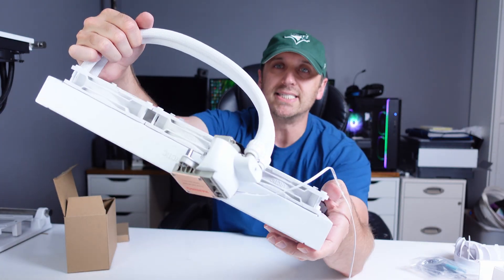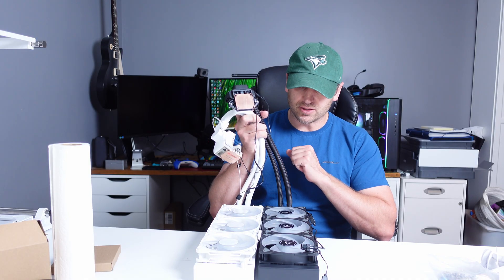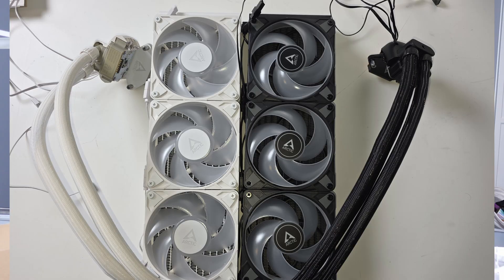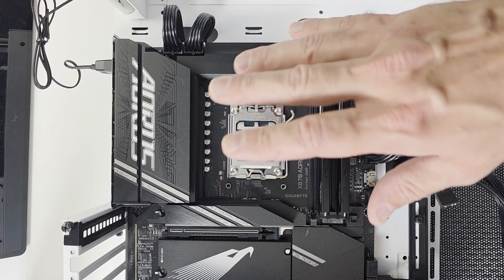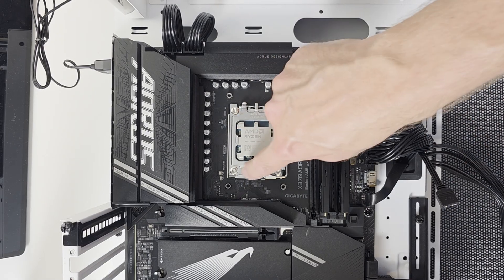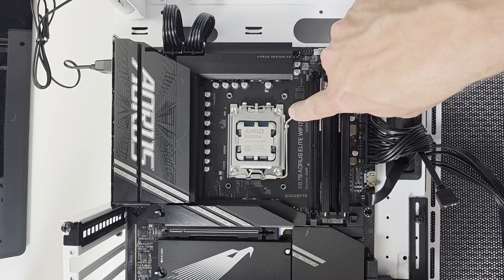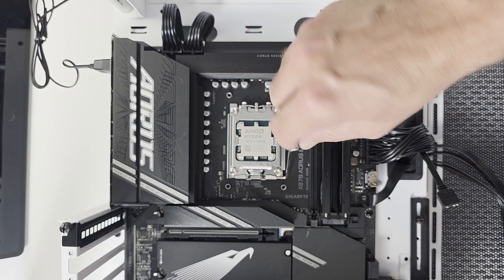Looking at it right off the bat, it looks almost identical to the non-pro version. Comparing everything side by side, the height and width are the same. The most obvious difference is that the pro model fans have seven blades whereas the non-pro has five blades. Everything else looks essentially identical. We're going to be installing this on an AMD AM5 Ryzen 7 9800X3D. For Intel users, the bracket holding your CPU in needs to come off and be replaced with this mounting bracket — make sure to take the tension off by opening the arm before undoing any screws, otherwise it will just pop right off.